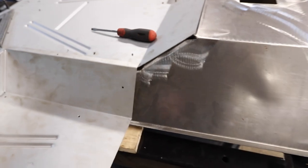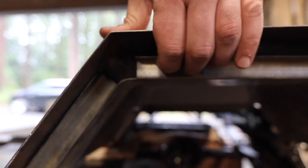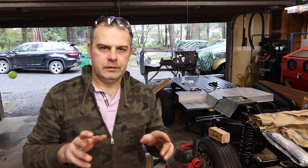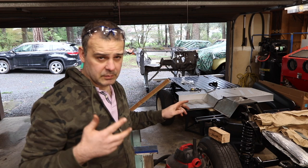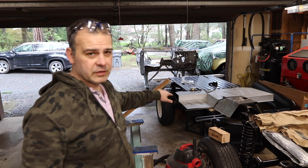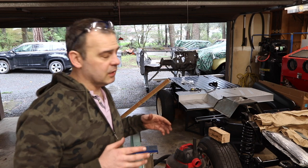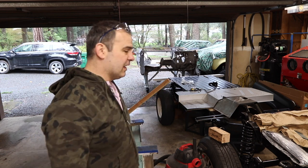I've got that flanging tool that'll bring it in — but that's too much for body filler or seam sealer, so I need to somehow get that in more. The other problem I found is there's a gap here that's not getting filled — this brace is not cut to the right height. I've heard that sometimes the 4R70W transmission, which is the overdrive transmission I'm using on this build, interferes with that brace. So once I get the tunnel figured out and get the floors clecoed in, I'll take it apart and put the engine, transmission, and transfer case adapter on.